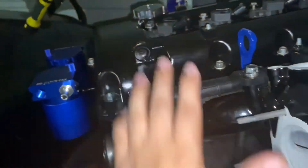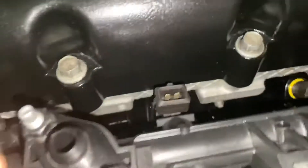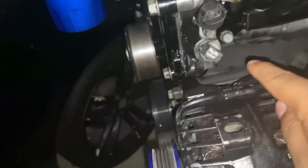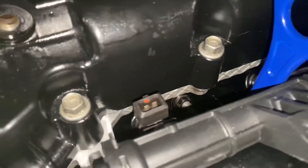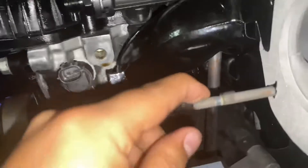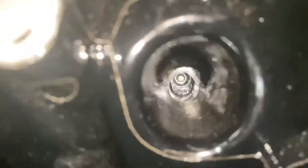After the fuel line fitting I installed the intake manifold. It's held in by five 12-millimeter bolts and has a gasket. Four of the bolts are fairly accessible, but one bolt is the trickiest — to get to it you need a swivel adapter with an extension and work it into the small gap. The other bolts are straightforward to reach from different angles.